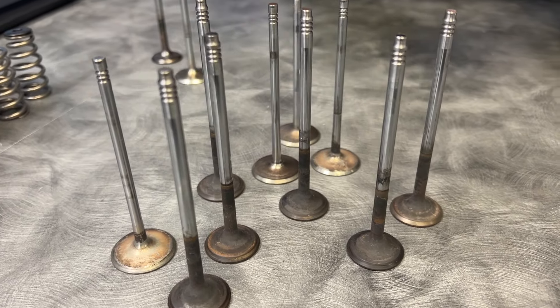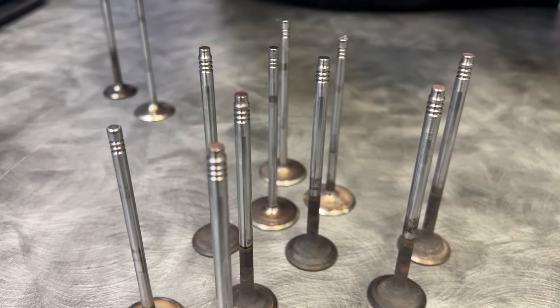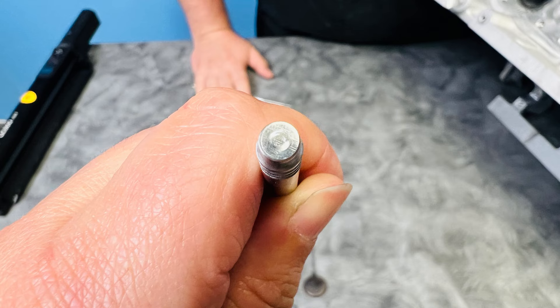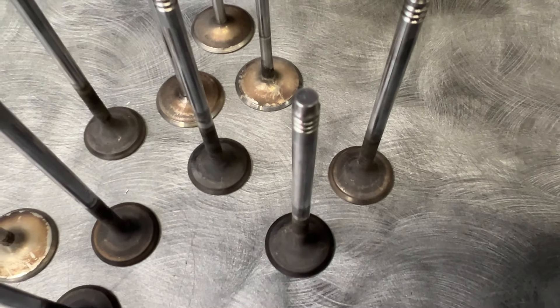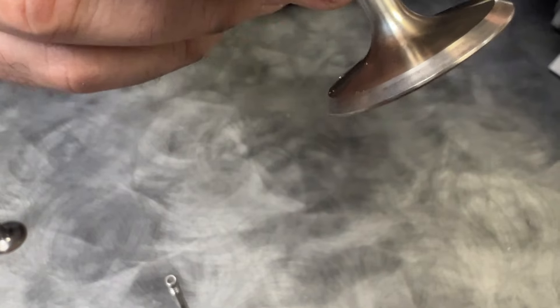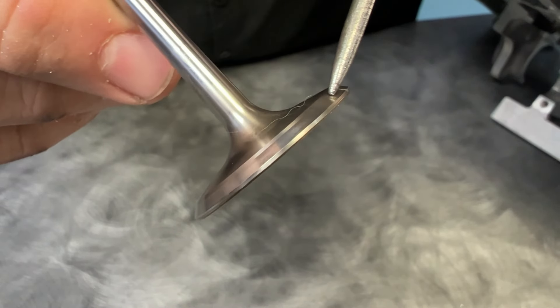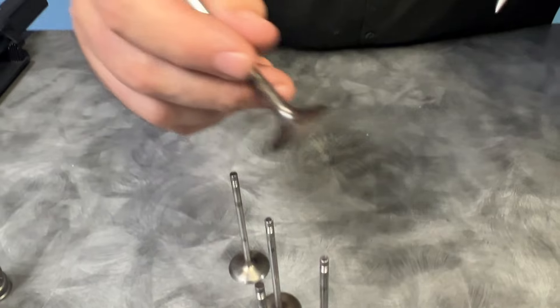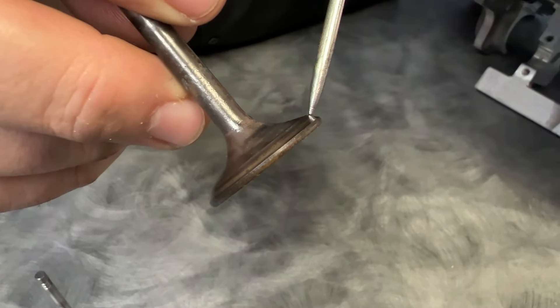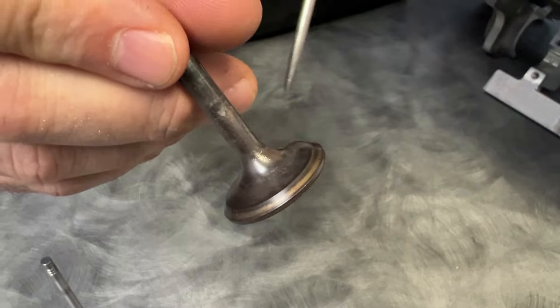On the valve side, I've seen a lot of valve float, and there were some valves that are bent and deformed — that's from a lot of heat and from valve float. You'll see it on the tip of the valve: there is a little indentation from the rocker hitting the valve. Basically when it gets out of time, it's slamming things and creates a little wear mark on the tips of the valves. There's also a little shelf visible on the valve itself. The exhaust valve looks pretty good after all these years, but there absolutely is some valve float, and I think that's because the valve spring just wasn't up to the task.